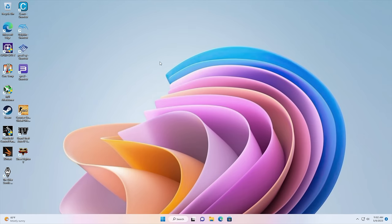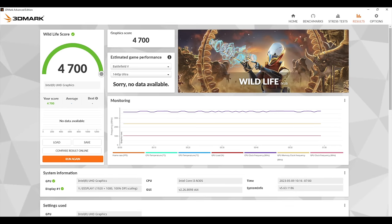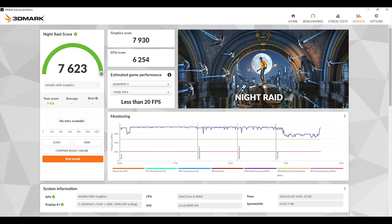Now let's look at some benchmarks. In Geekbench 6 we got a single-core score of 1,269 and multi-core of 4,860 — definitely higher than other N-series chips, though I was expecting a bit more from single-core given the 3.8GHz boost. For GPU benchmarks with 3DMark, the Wildlife Vulkan benchmark scored 4,700 and 3DMark Night Raid scored 7,623. I was expecting lower scores since we've got built-in UHD graphics running up to 1.25GHz with only 32 execution units — nothing close to Iris Xe with 80 or 96 EUs. But I still think we can get some gaming and emulation out of this.